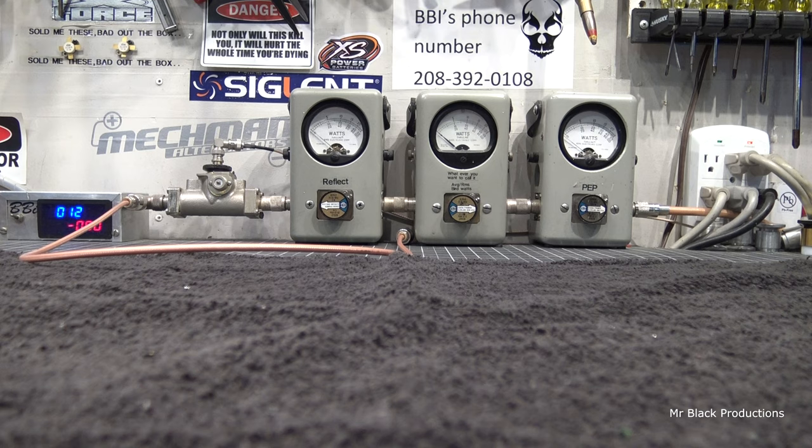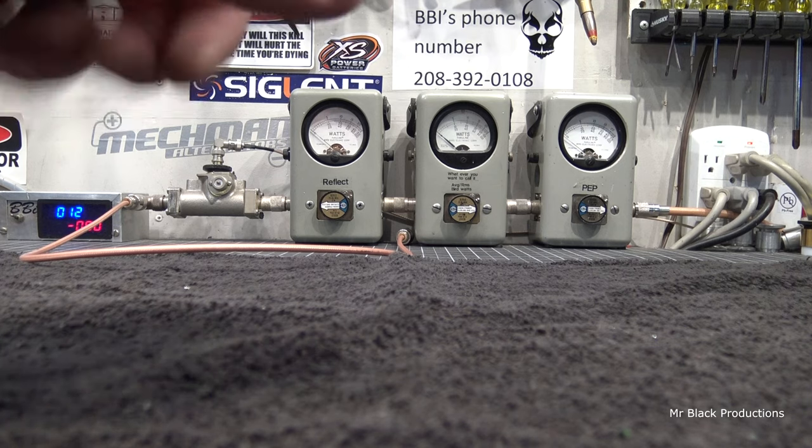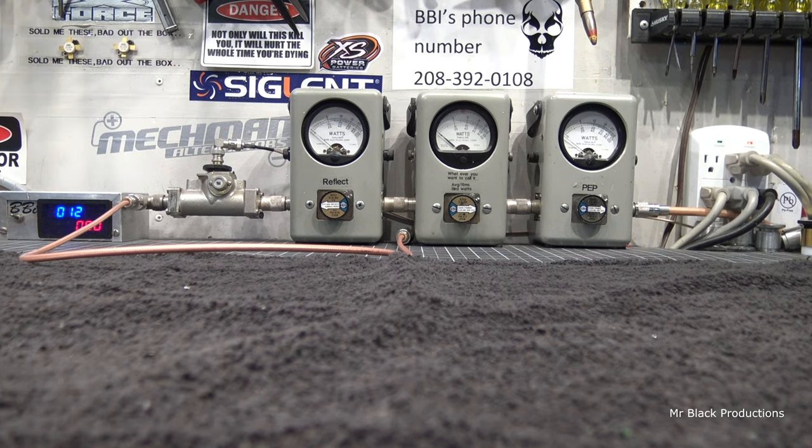We'll look at my business partner's truck. Every time we keyed down his 24 pill, it would set off his windshield wiper pump, like we were sitting there pushing the switch on the dash. We had to go down and isolate the windshield wiper pump so it wasn't being driven by the signal from the computer. We could never get it out of it. We tried a ton of different stuff. We ended up just putting it on its own switch, and that fixed the problem.